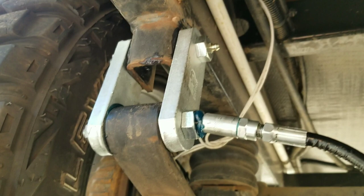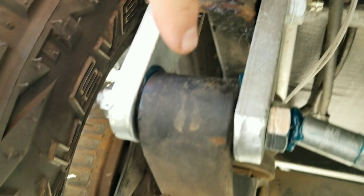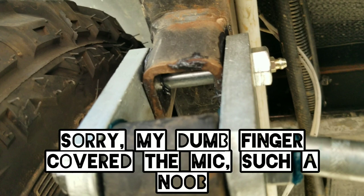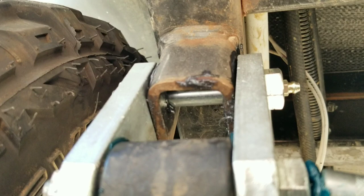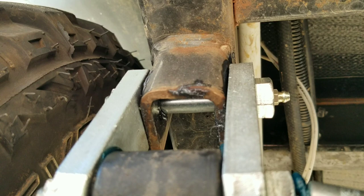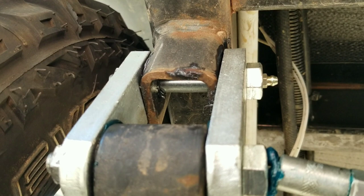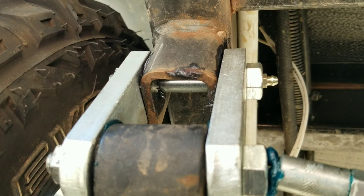Pumping grease in from underneath the trailer. You can see the arc of grease coming out the holes on both sides — that means it's greasing properly. The top mount is still the issue I mentioned — no steel tube means the grease bolt would just squirt grease on the ground rather than lubricating anything. I'll need to fabricate a steel tube for that. Other than that, the job is done. Wheels back on the ground and there's no squeaking — that's exactly what we were going for.